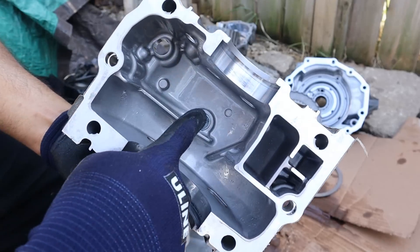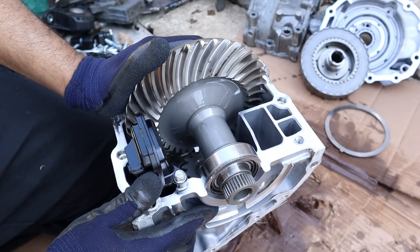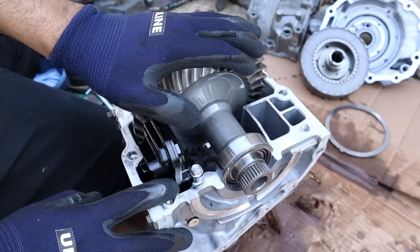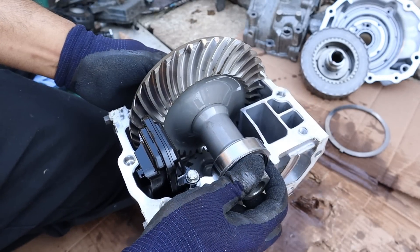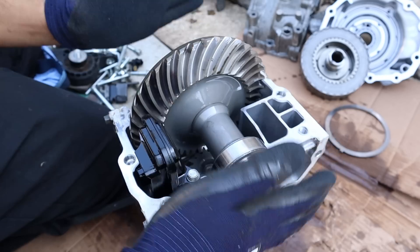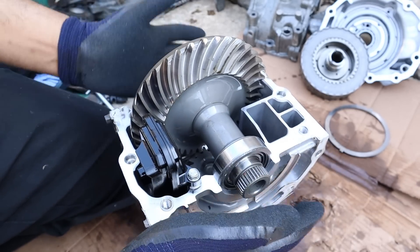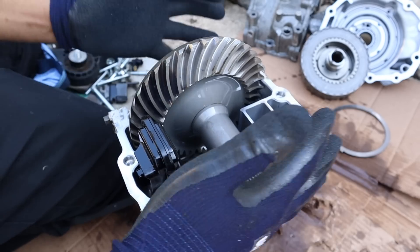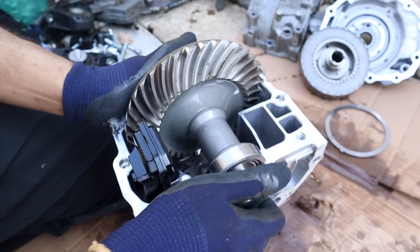Pop off this rear cover. Here you can see that's the fill port inside of there. So it turns out this is not an open differential at all inside — in fact it's literally just the pinion gear inside of there driving this giant ring gear, and it's solidly connected to the two clutch packs on the outside for your output. So instead of using spider gears inside of here like an open differential, they're relying on the clutch brakes on the side to give the differences in wheel speed when you go around corners. That's not the best for the longevity of the clutch packs because they're always going to be slipping as you're taking turns, but this is a much more compact way of doing things.